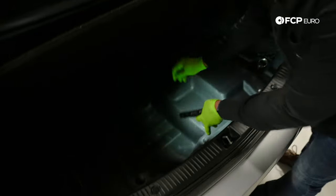As you can see, changing the auxiliary battery on this C300 is not a bad job at all. Things to keep in mind: if the unit is burned up, check that fuse in the trunk. Additionally, if you're changing your main battery, also consider changing this at the same time — they're fairly problematic. If you have any questions at all, be sure to leave them in the comments below. Like and subscribe. Thanks for watching.